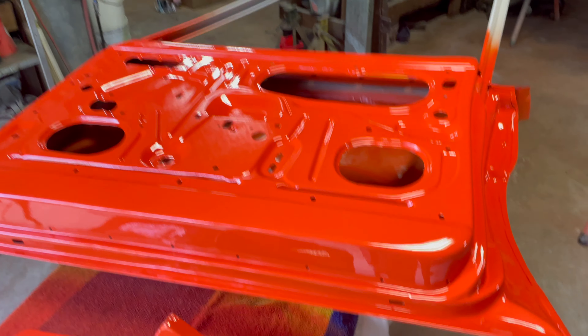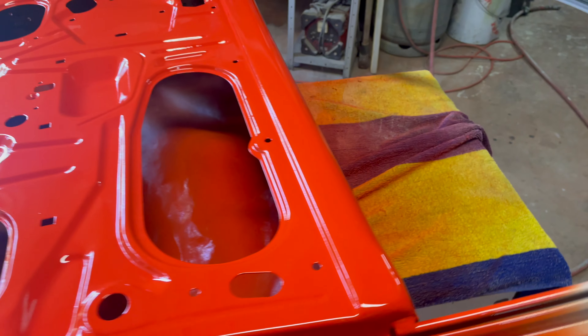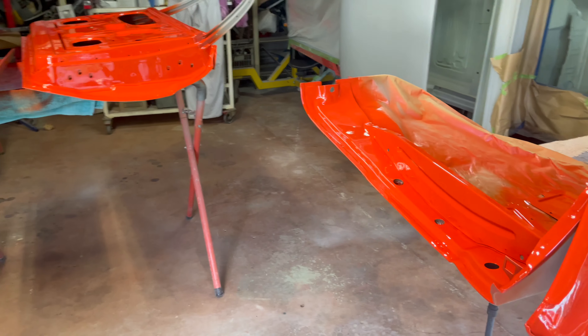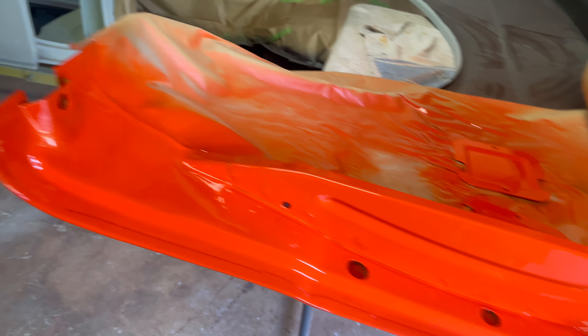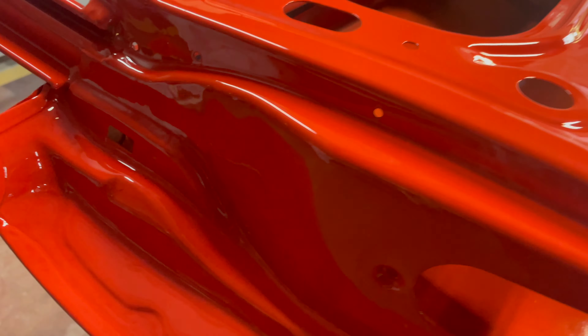Another quick peek — I'm pretty pleased with it actually. Even in a paint booth you can't get 100% lint-free environment, and this is actually pretty good. I vacuumed my floor twice, damped the floor down to settle the dust, used the tack rag. It's a good time of year — not too many insects, early in the morning, nice temperature. Everything was working in my favour and it shows — there's almost no contamination in this at all. I'm pretty damn pleased about it.